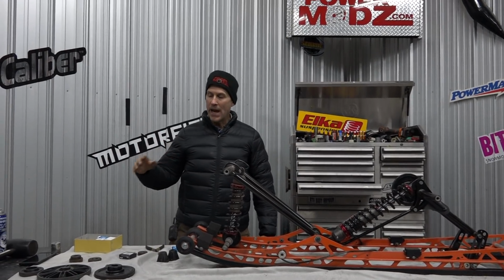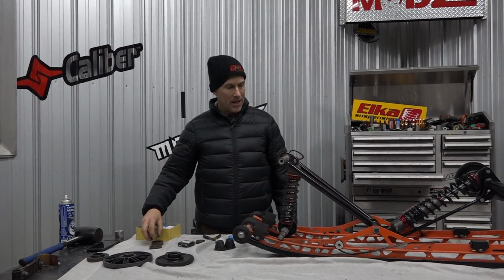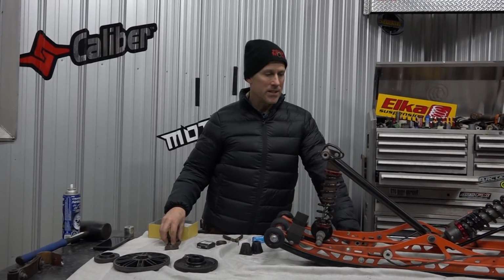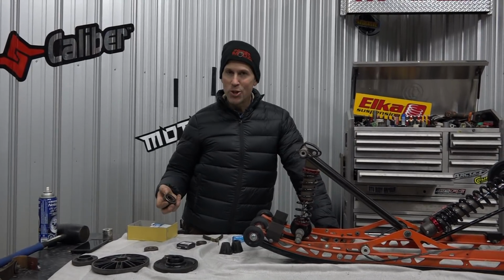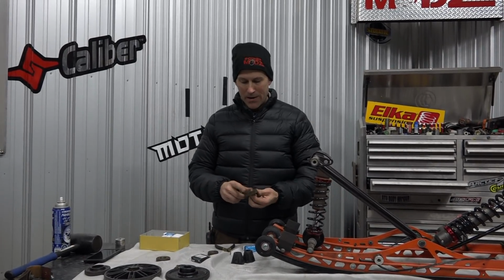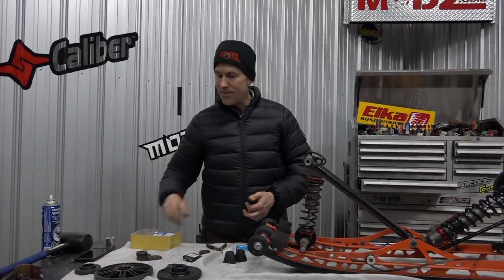You know, up here in Canada, we deal with a lot of road salt. Some of your states may be down there, I'm not sure. But to be honest with you, I'm not running the roads. We don't really trailer it. We do have it up on my sled deck, but that generally keeps it out of the salt. I think it's just snow. Snow, a little bit of salt, hot and cold temps rust these bearings out. The bearing sealing surfaces get pitted, and then these just take a big giant dive in the garbage.